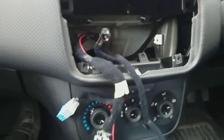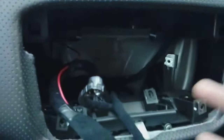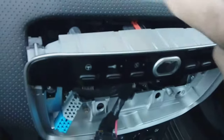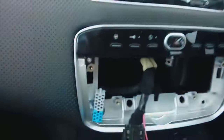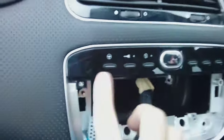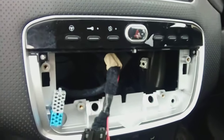Once all your little bolts are removed, you can simply remove the metal frame. This piece won't be needed — put it safe with the radio in case the car is ever sold and you want to fit the original radio back. You're left with this piece, which can be refitted back into the car — the reversal of what you did to remove it. Put your bolts back in; you won't be able to put everything back as you've removed the actual frame, so you're looking at two bottom bolts and two plastic clips at the top. When putting your plastic surround back in, don't forget to plug in the multi-connector on the back — it shoves in, then push the red bar across to lock it. Line up the top locks, feel for where they go in, and give them a firm press. Then put your two TX25 bolts back in at the bottom.